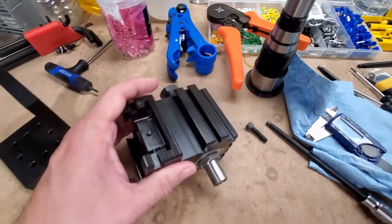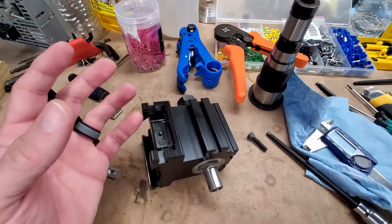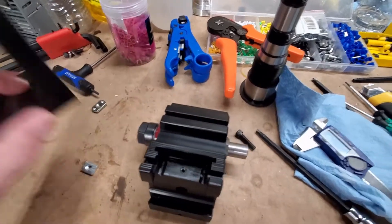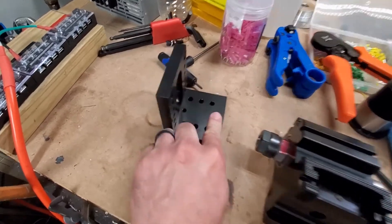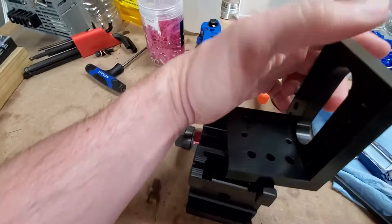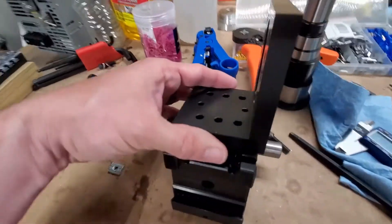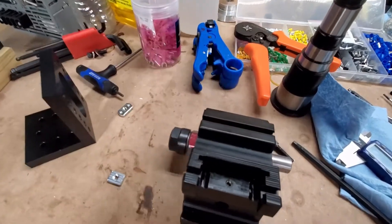So in a nutshell, I'm going to re-explain it. You're going to use the two T-nuts in here. Take off all of your old motor mounting stuff — there should be two T-nuts in here, and you're going to use those same nuts. Then these holes right here — those are what you're going to use. You may have to get a couple new screws. You're going to screw this into here, into those T-nuts, and then you can adjust it back and forth until you get it just where you want it. And then you should be done — that's all it takes.